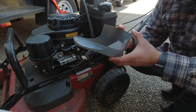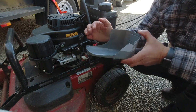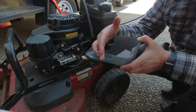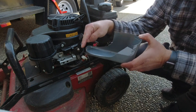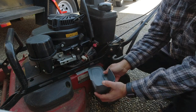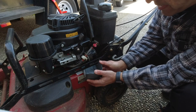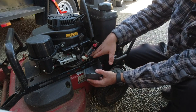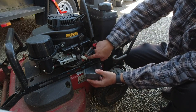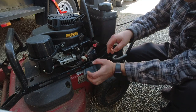Essentially, this is all you need for an oil pan — just the bottom of a container like that. Cut one side thin, just leaving the lip around there, and keep the other side a little bit taller. Then you slide this underneath that bar on an angle, just so it's under the filter. The filter is angled, so the oil is going to come out of this front corner, and that way it just pours down here and stays inside the container.